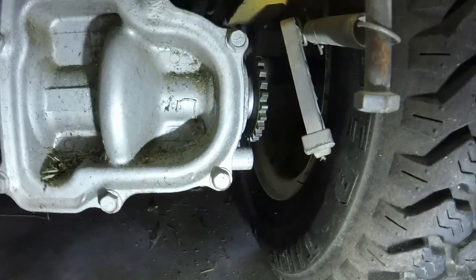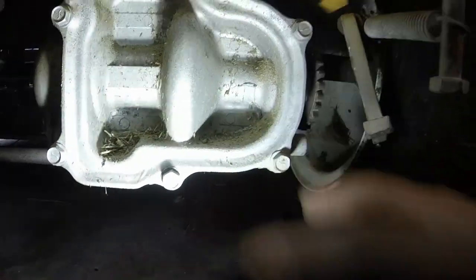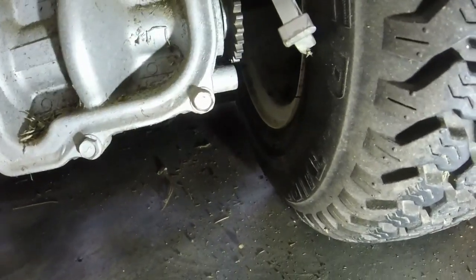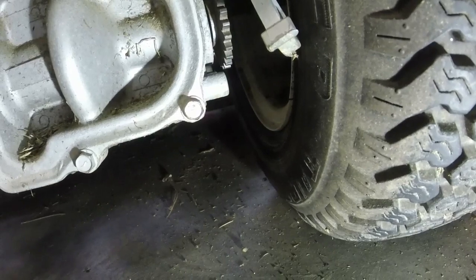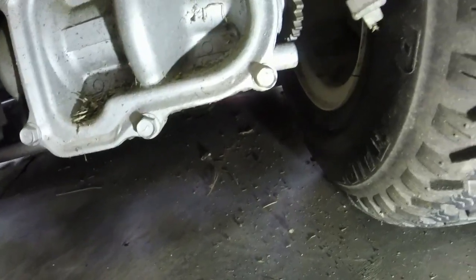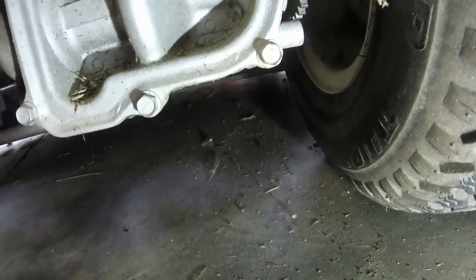So you see this piece right here? It's actually snapped off the back mounting point on this transaxle. So what I believe I'm gonna have to do is drill that bad boy out. Get a new shoulder bolt, bolt it in to match this side, it looks like. And that side is just a regular bolt, but